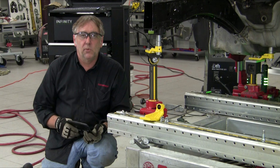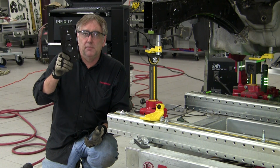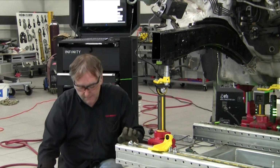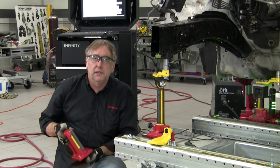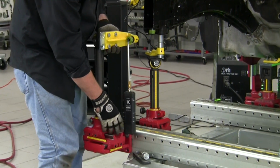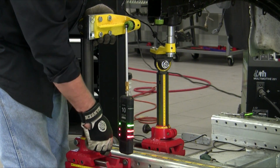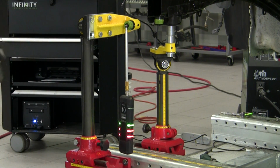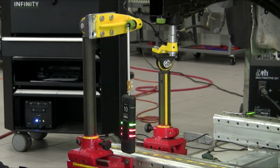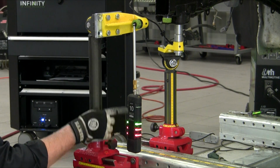Okay, with the majority of the weld welded in position, one last thing to do is positioning this bumper mounting plate on the front of the rail. To do that, we're again going to build a fixture to lock it in place while we weld it. We set our target in place, establish our length, width, and height again using the LEDs on the target side.